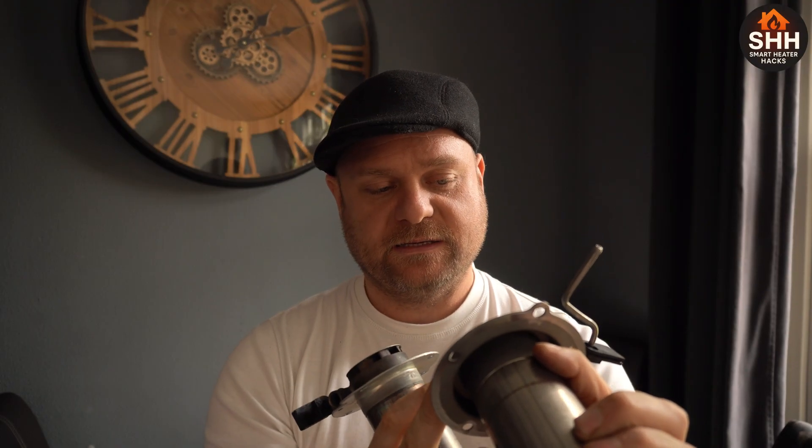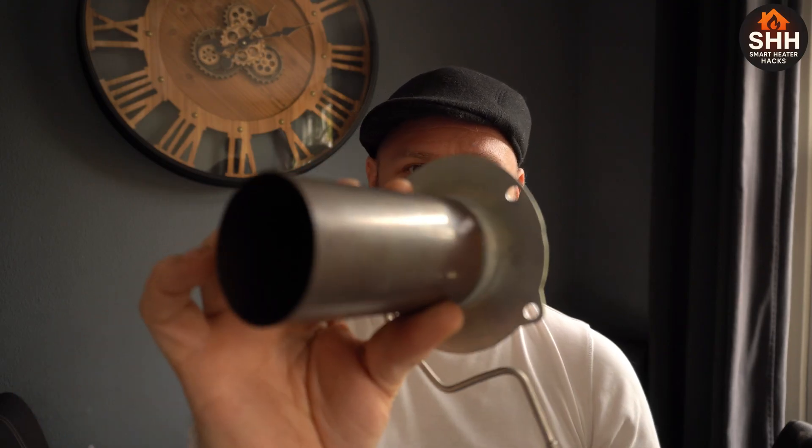Just by weight there's a really big difference. The combustion chambers are completely different — this one is deeper, and this one has a channel so it opens up the combustion chamber, providing a couple of cubic centimeters more air. The biggest difference is inside. When you need to replace these things, you're better off buying the upgraded version just because it's 310s steel, thicker wall, and actually cast. The other looks like cheap galvanized steel with a very thin wall.